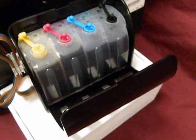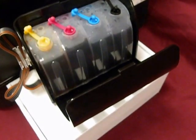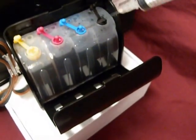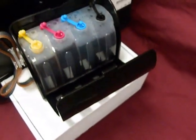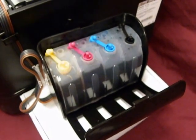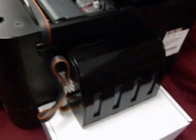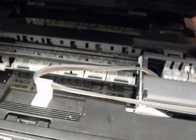You close off the air plugs and open up the big one up front — that's where you're going to fill it. One plug has to be in when you're filling up the ink chamber. We gave you a syringe with a long tip — draw up ink from your bottle and then fill it up. The syringes work a lot better with these tips. Sometimes bottles with pour tips wind up splitting and leaking, which is why we don't use them. I've balanced it, closed it, and it's right next to the printer. Now I'm going to plug it in and we're going to do hose travel.